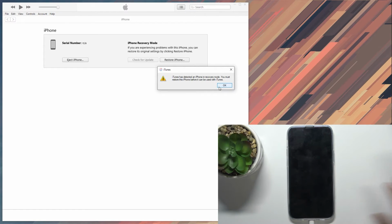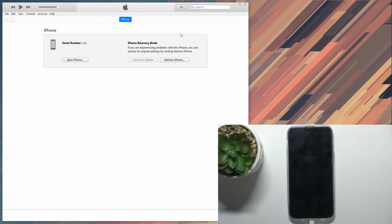So as you can see on the phone side, there is nothing really visible on the phone. It looks like it's just off, but on iTunes side, when it's plugged into the computer, it shows us as recovery mode, which is incorrect, but whatever. So from here, simply select Restore iPhone, restore and update, and this will begin the process. Now, it is fully on autopilot now.